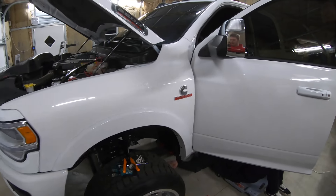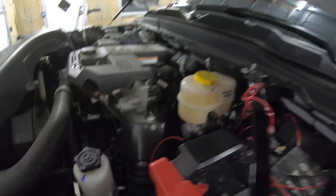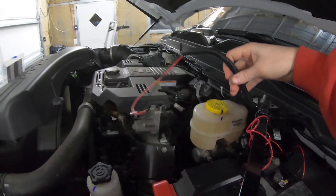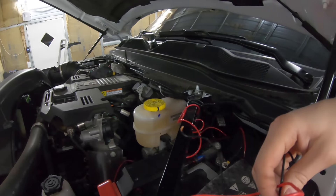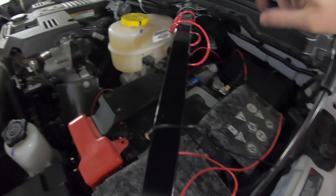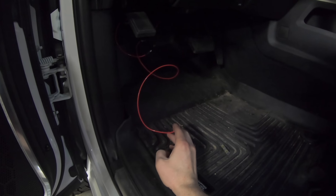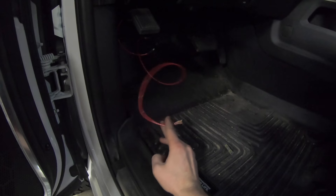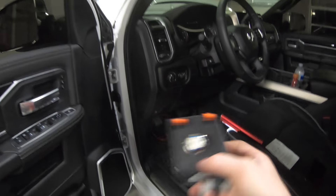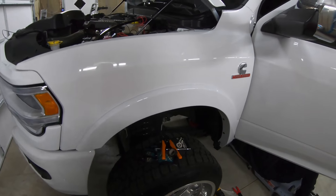It's been hard to show everything while videoing, but basically we have the whole right side of the truck coming across with some wire loom right here — the front rock lights here, these fenders here. We're going to splice them all into one. I have the switch already wired up, then going to the battery terminal, and that goes inside the truck. Wires come out underneath the footwell and go through the firewall to the back of the switch. Been crimping and soldering them all together.